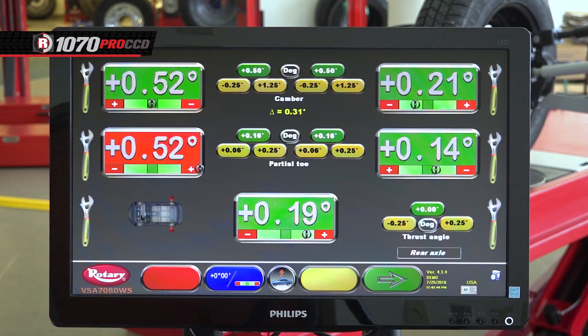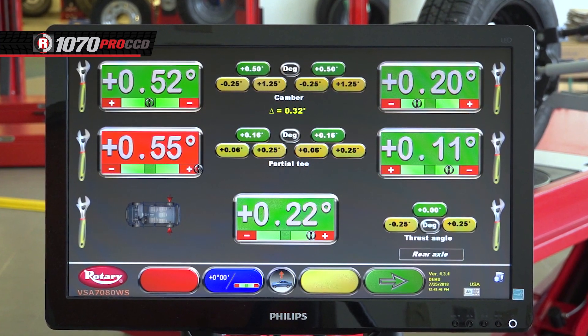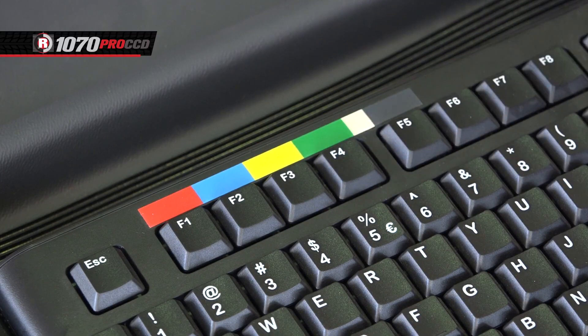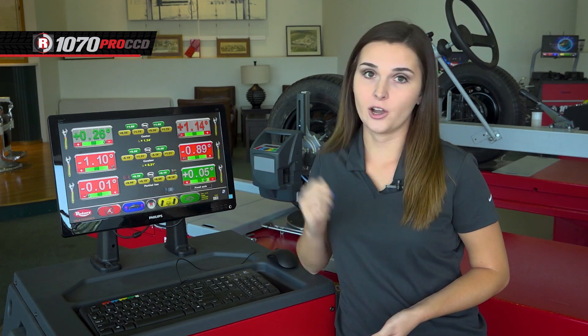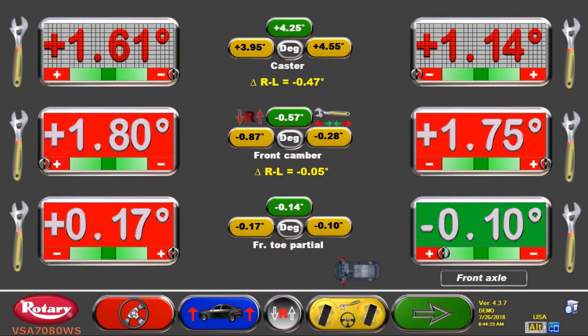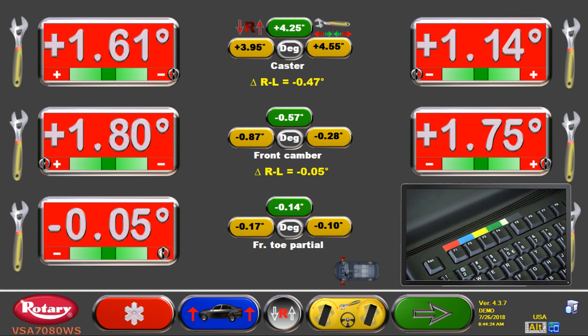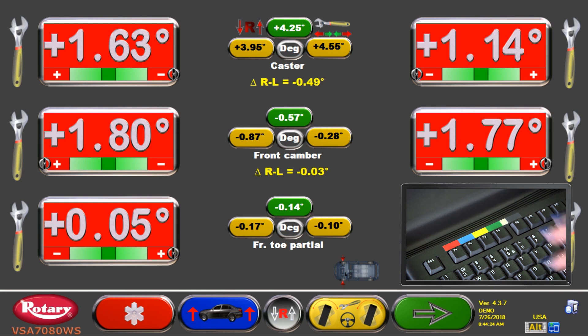Here you will be able to see your adjustments being made live on the rear of the vehicle. To move to the front of the vehicle, press the green button. While adjustments are being made to the front of the vehicle, the caster readings are frozen. If you need to make a caster adjustment, you can unfreeze the readings by pressing F5 to index the caster readings and then press the red F1 button. This will allow a live caster adjustment. Once the adjustments are finished, hit the red F1 button to freeze the caster readings and then F5 to index the camber angles.